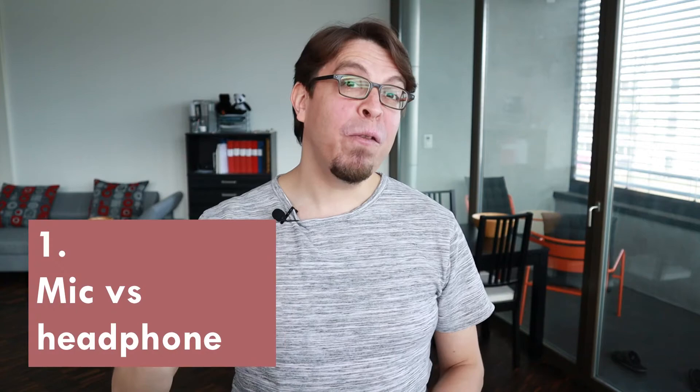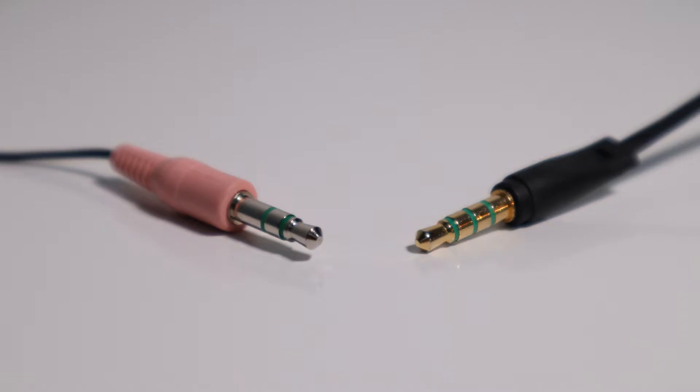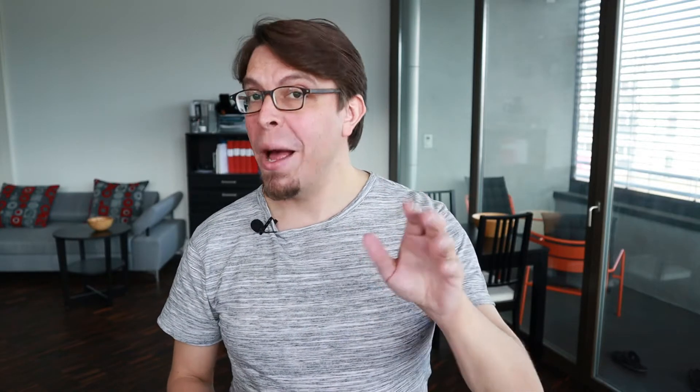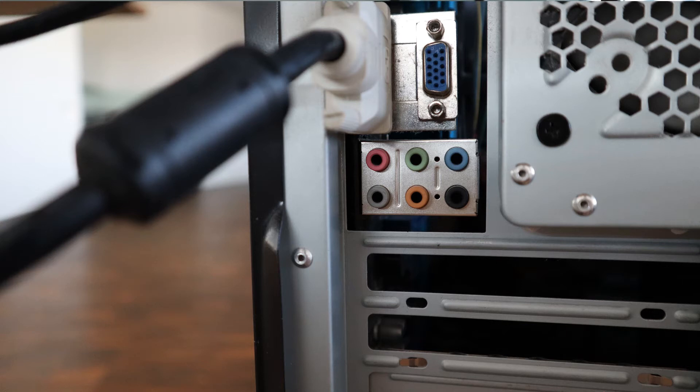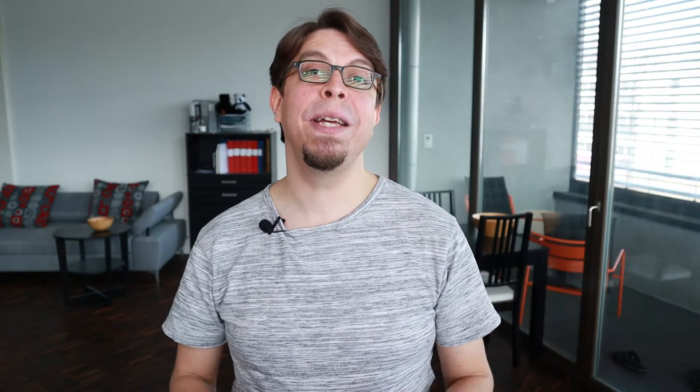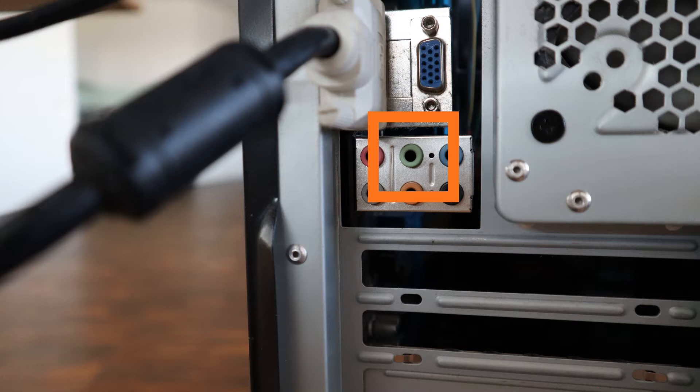The reason why you have to be mindful when connecting a microphone is that microphones and headsets have two different types of connectors, but they look very similar. A traditional 3.5mm microphone connector has two bands. If it has been designed to be used with a PC, the connector is often pink, and the microphone input on a traditional sound card has a pink color as well. For headphones, the connector is physically exactly the same — it also has two bands — but if designed for PC, it's often light green, and the sound output on the sound card has the same light green color.